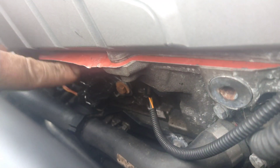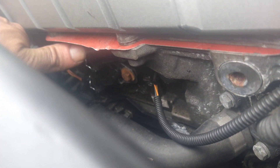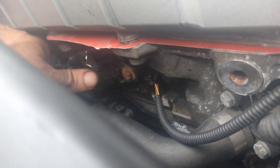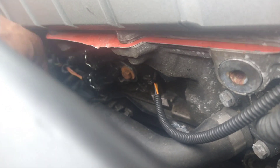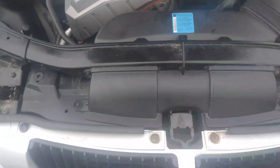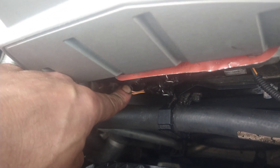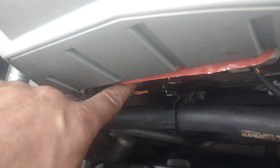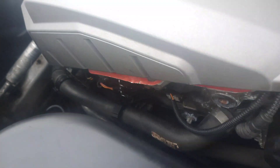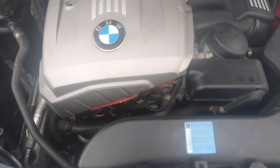If you want to remember which way these go - there are two solenoids, they're both the same. The top one is for the oil control of the Vanos for the inlet, and the bottom one is for the control of the exhaust. I think of it like an oil change - oil goes in at the top and out at the bottom, so inlet is at the top and exhaust is at the bottom. For the wires, the red stripe is for the exhaust - red for hot - and the other one above it has a blue stripe, like cold air going in, hot air going out.